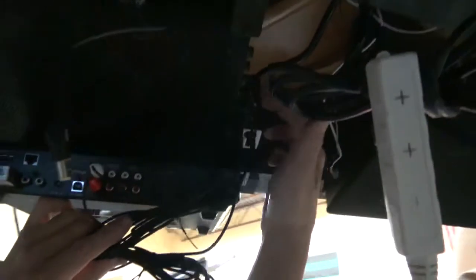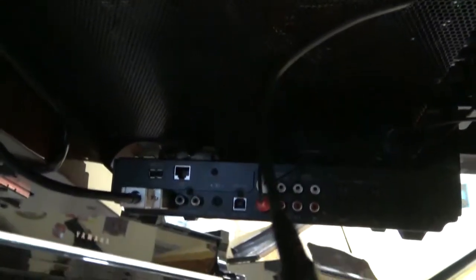There are two outputs for the background music, and the DKC850 came with these two wires. So you're going to connect output red to red, white to white. These two wires came with the unit, and then the other end gets plugged in to the auxiliary in. As you can see over here, it says 'auxiliary in' — so that's so the background music gets heard. Then you can take these two wires and shove them up in here out of the way so you don't see them. So that's that connection.